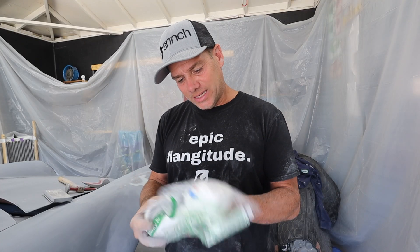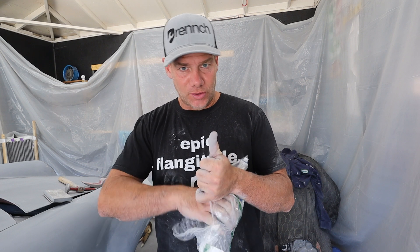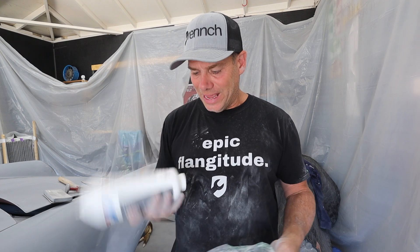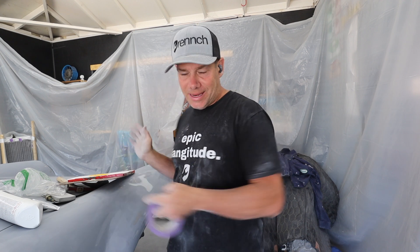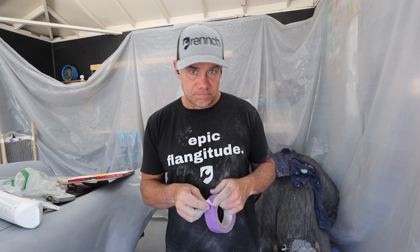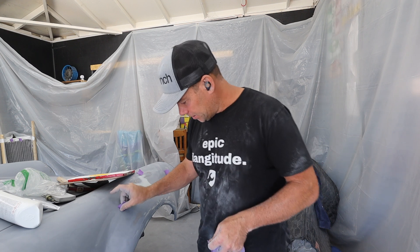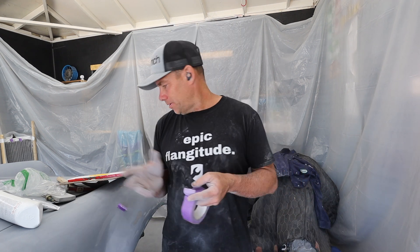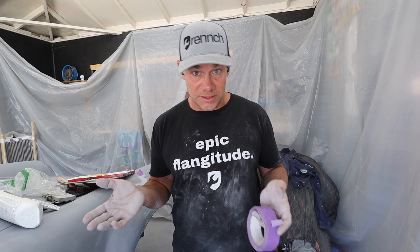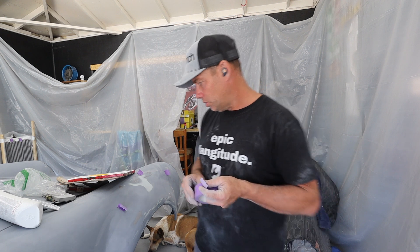I'm going to use USC Icing — it was the best-reviewed final glaze on Amazon. This is basically really fancy, super smooth Bondo. One habit I've gotten into is putting little pieces of tape on the car where I want to apply the glaze, because after you've mixed it, it's easy to forget exactly where you need to apply it. You only have about three minutes before it sets up and you have to get it on the car before it gets hard and terrible to spread.